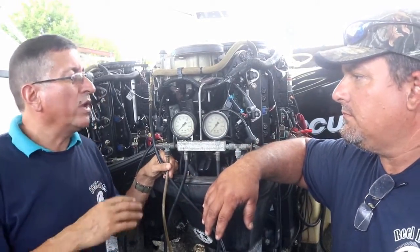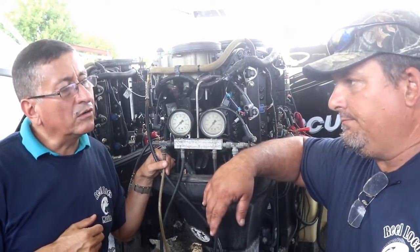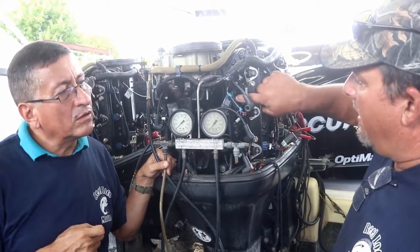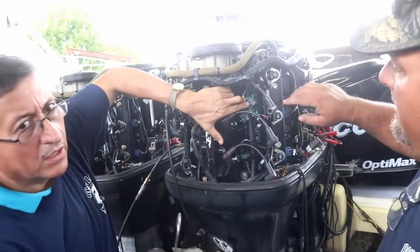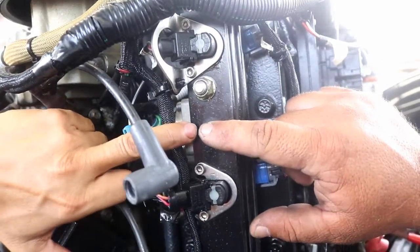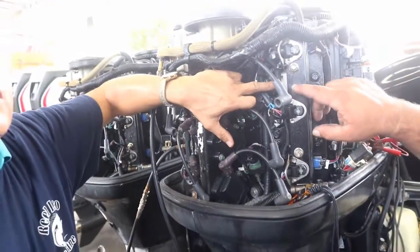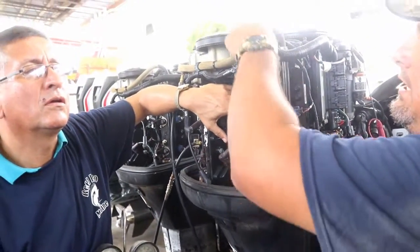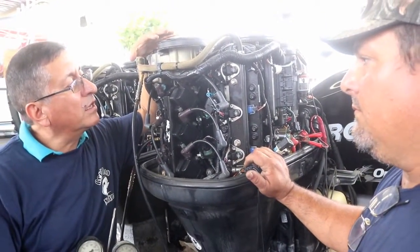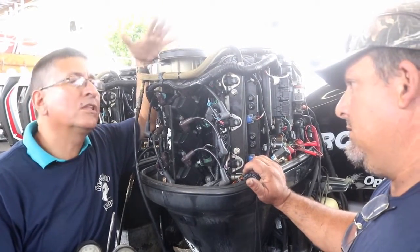What is the symptom when both of them are below? Well, first of all, it won't run. Especially in some cases, on these they have what they call a tracker valve, which you see here. This is what separates the fuel and the air. When that diaphragm goes bad, you'll now have fuel in the air side. Is it possible to disassemble the rail and replace the valve? According to the EPA, no, you cannot. They're not repairable. You need to replace it.